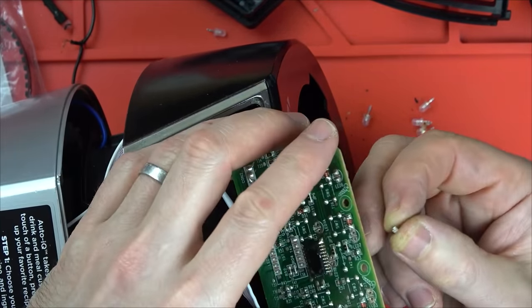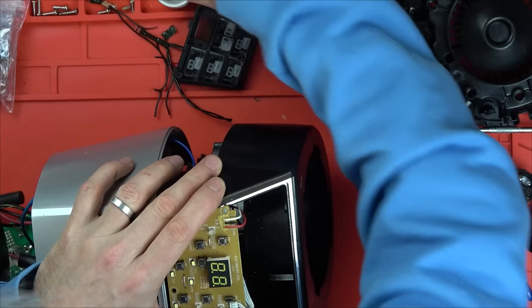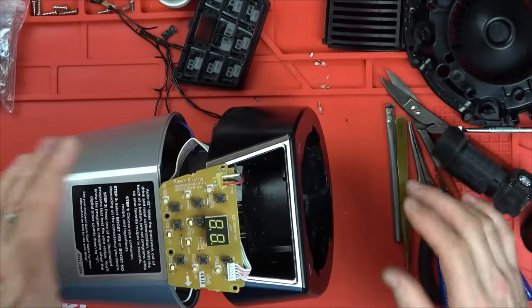Right, we're done. That took about 15 minutes - not too bad, quite therapeutic. It's amazing how quick they turn to scrambled egg - put your soldering iron on that just a little bit too long and it's just like a melted pot of yellow goo. But I am actually very happy with these ones here. I noticed on my very last one - which is irritating - that there's a little corner taken out. That denotes the side that needs to go to the big side, whether that's anode or cathode. You can see a little corner bit taken out on each one. So the contacts are underneath - soldered underneath.